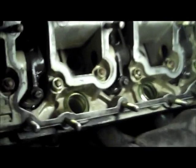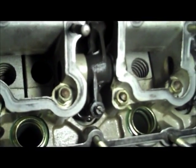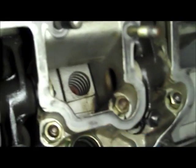Now on the lower right hand side of the engine, with the valve covers off, we're going to go ahead and tighten up the cylinder head bolts, and those are 10mm Allens, and they are located, 6 of them, in these holes here. So you've got one on the outer edge here, 2 in each of these, and 1 in the other outer edge.